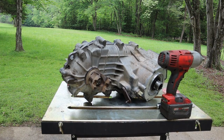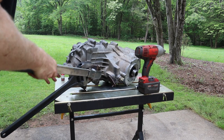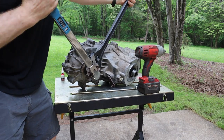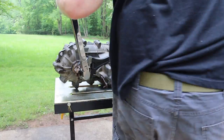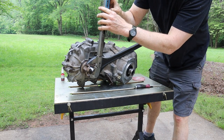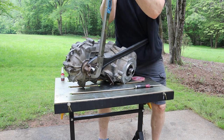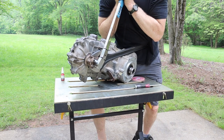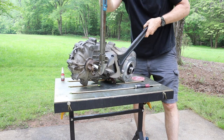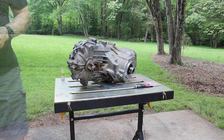And let's see if we can finish it off with the torque wrench. On these, I'm seeing the torque value as 150 to 180. So let's see what I can get here. Oh, outstanding. Let's try 165. See if that works. All right, 165 sounds about right to me with some red Loctite. I don't think that's going anywhere. Folks, I think we're done.